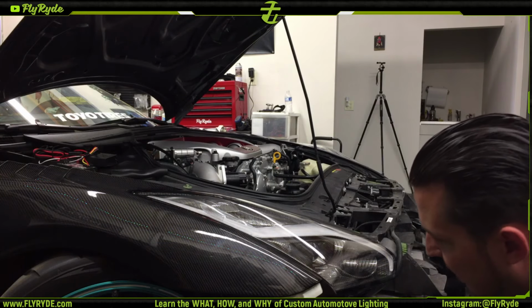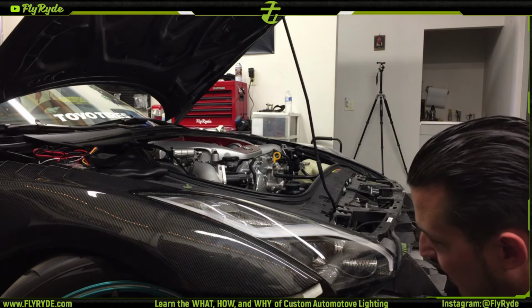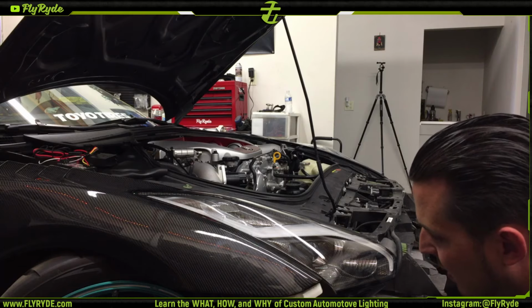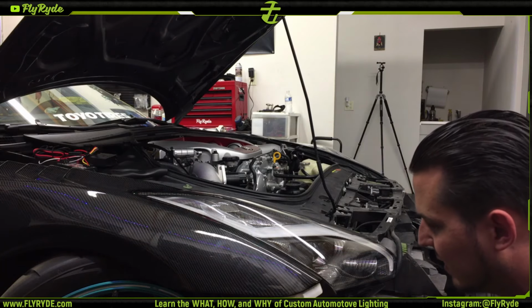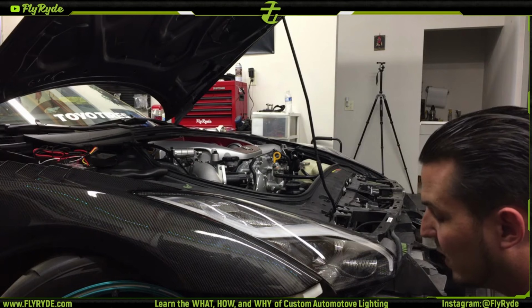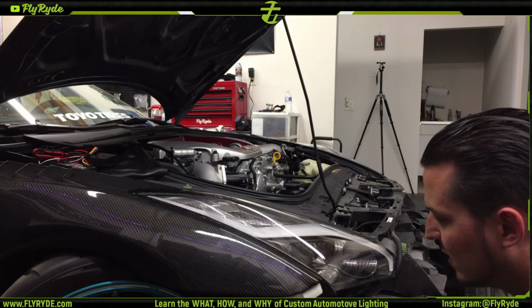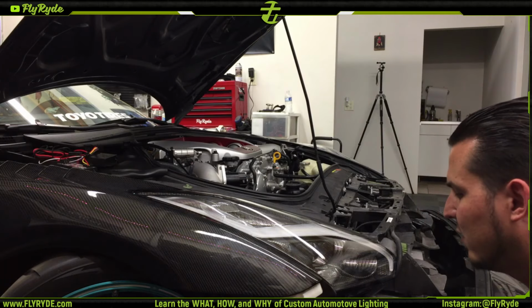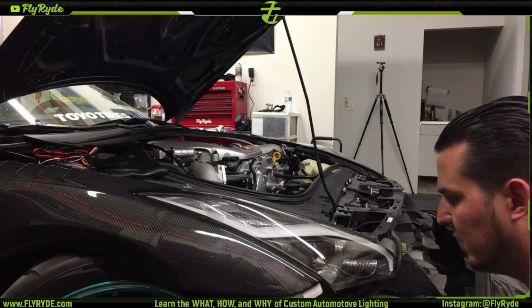You've also got this connector, right? This connector is the DRL circuit. That's very different. Daytime running light and running light are very, very different. Daytime running light is going to shut off with the parking lights. Or I'm sorry, it's going to shut off with the low beams, my bad. So anything that's on during the day, that's so that you can see somebody driving at a distance that does not have their low beams on. Parking lights don't necessarily matter much.